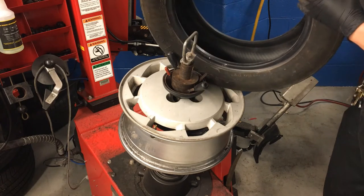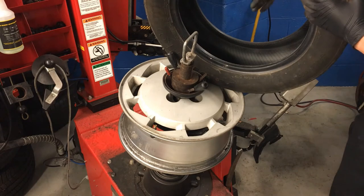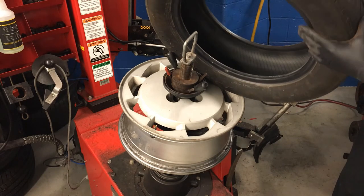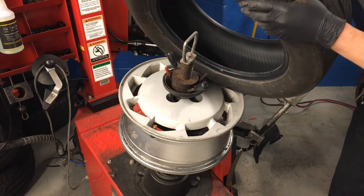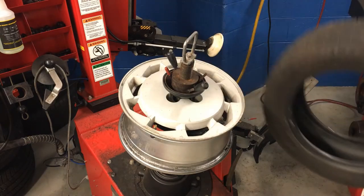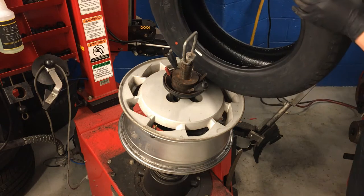Now I need to separate the bottom bead as well — you saw me pull up on the tire a little bit. We've got to do the same thing for the bottom bead, and this is where you need some hand movements. If the rim gets loose, snug it up again. Bring the valve stem back around just past the head, come in with the tire iron, lift up on the whole tire, and pry up and over to get that bottom bead. Go around, and our tire is off the rim. If you were just taking this tire off to repair it — do an internal patch or some service — you'd want to mark which side was inside and which was outside with a tire crayon before setting it aside.